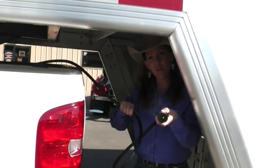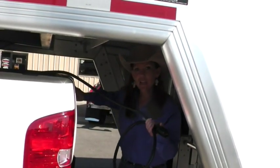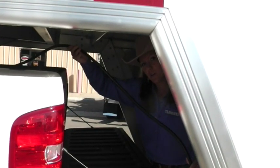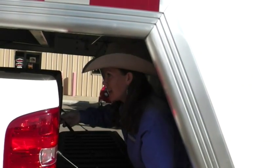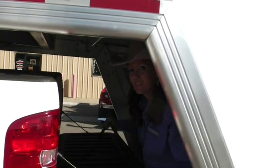I always take — just to be sure for safety's sake — our seven-pin plug and hook it up to the truck. This particular pickup has got a plug in the bed, and I highly recommend that; it makes it so much easier. The plugs over the bumper work fine, but the cord hanging down can catch over the bumper when you turn sharp enough, and it will yank the cord right out. They're just a pain — a hundred bucks saves you a lot of trouble and heartache.